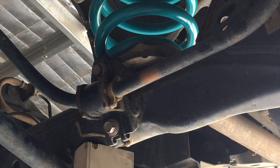Doesn't matter what you put the wheels on with, as long as you don't apply more pressure. You've got to do it evenly, okay? Even pattern, right? You don't want to be tightening up a wheel when it's cocked up sideways, all the nuts are tight and it's not on right because you tightened one too much before you got to the rest, right? As an example. It needs to be done evenly, and you want to finish off with something that matters.